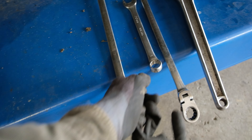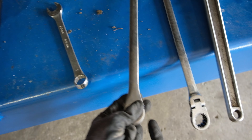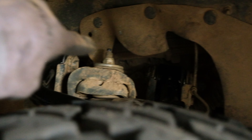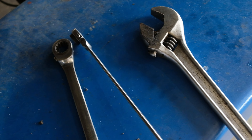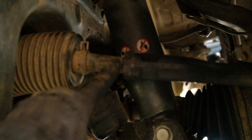Last tidbit: tie rods are a 20 mil. If you've got the 555s, the cam bolts — the big cam bolts on the inside — are 22 mil, and on the outside those are a 19. I'm using these adjustable flex-head wrenches, and then this one is for the big nut on the tie rod. That should give you all the tools you need for success.